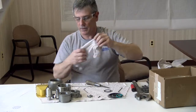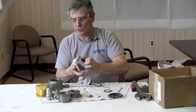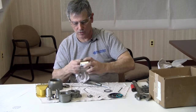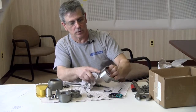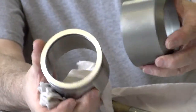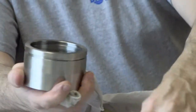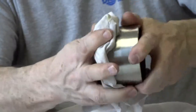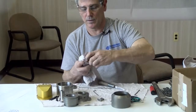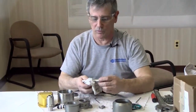I don't believe this adapter has been running for a long time, so it's still pretty clean. But you can see just a little bit of scuffing right here on the piston where it's been riding inside the sleeve. Of course, you want it smooth. They do have some tight tolerances — they have to maintain vacuum and fluid without having leaks.